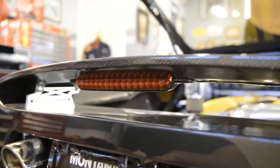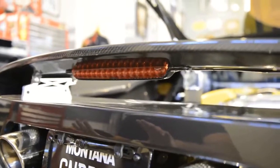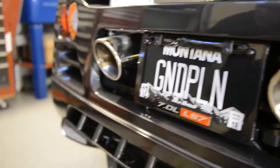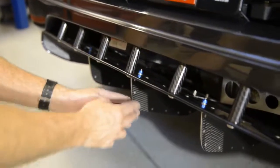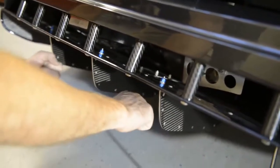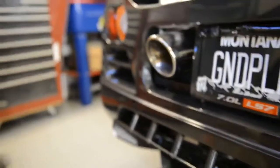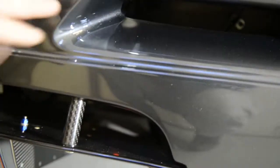'Man, I built this.' All this was custom done — more aircraft hardware. These are carbon fiber, double-riveted with airplane rivets, flush with a bucking bar and a rivet gun. These vents didn't come with the GTM, so all that bodywork and the fairing-in of these had to be hand done. All these lines were sanded, matched, and blended in. That's all handwork — it takes months and months to do that stuff.